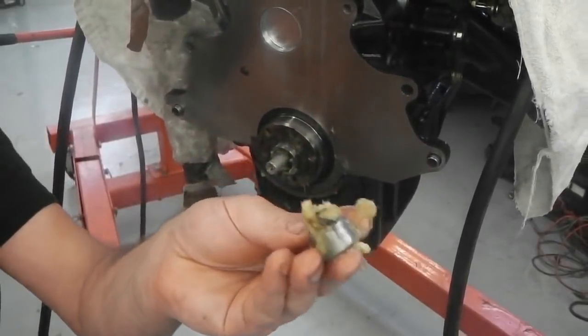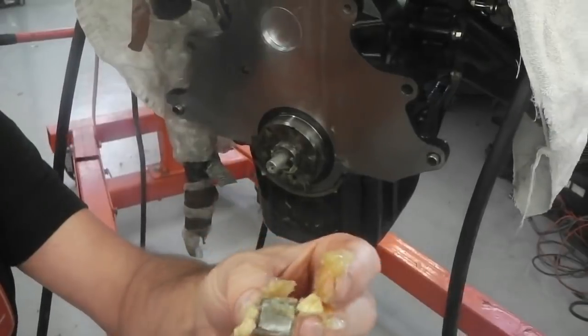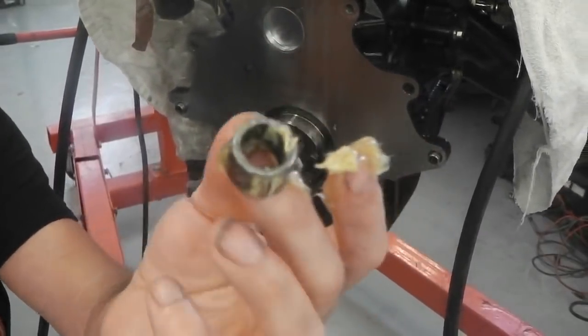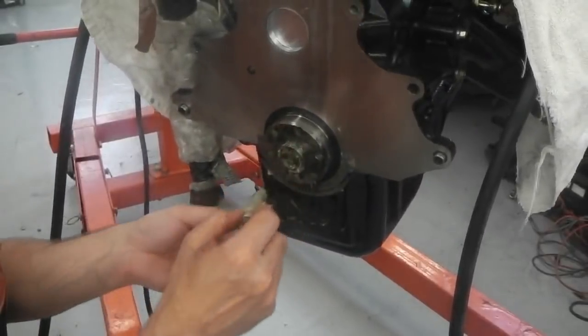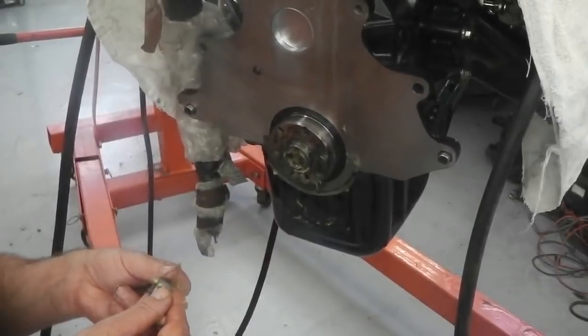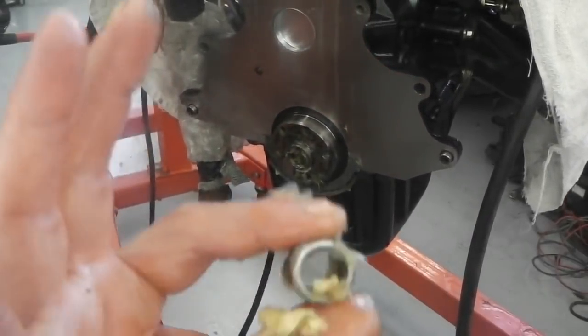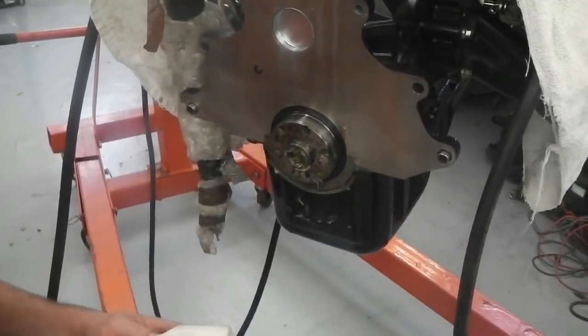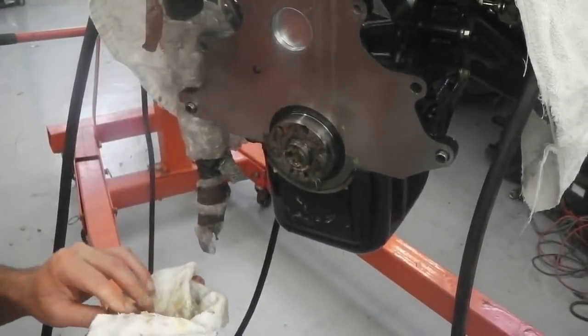Whoa! Okay. It bounced out, then I hit it back with the hammer. It actually went on the first hit. Spigot bearing out then. A little bit of hydraulic action was the way to do it. I've salvaged it, I don't think it's damaged. It could always be used for someone, but they're probably bent anyway. So that gets it out without any major problems.